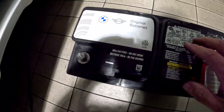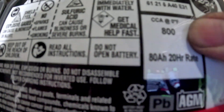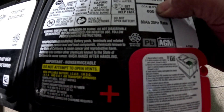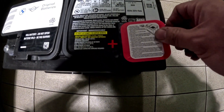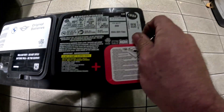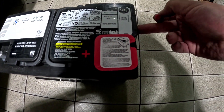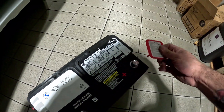We got the original battery — the original MINI battery, 800 CCA. There's a part number in case anybody wants to know. It's AGM. The new battery cover actually comes with one of the new plugs for that breather tube I was talking about. There's one hole on the back that I plug up, then the other one's for the breather tube in the front.